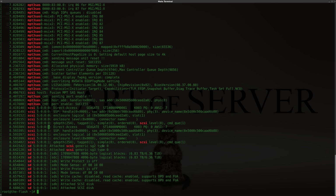So okay, that's really interesting how they're implementing this. That allows them to not worry about the secondary SAS channel, because if you use the secondary SAS channel, I believe that it shows up with a secondary SAS address. So instead of a different LUN number, it would be a different target. That's not what Seagate is doing with these Mach.2 drives. They're simply implementing it as a different LUN within the same target.